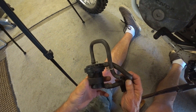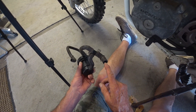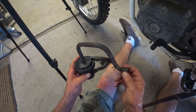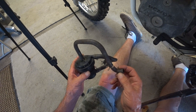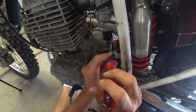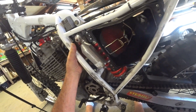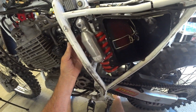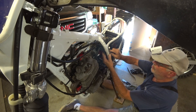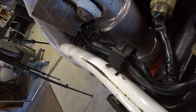I've got this breather system I need to put on — this is kind of a rare bird. It's a closed system crankcase breather. Crankcase gases come up from the crankcase, go into the top of the breather. Excess air goes into the air box inside the air cleaner. Oil that gets separated drains back into the motor — closed system. Somebody who had this motor before used a K&N filter right here on top of the crankcase. Apparently it's got to go up and over the top of the shock somewhere.